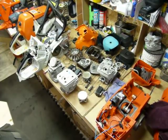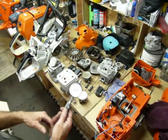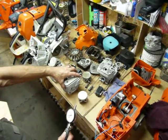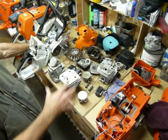That time is coming shortly, so we will be doing that. When you check the bore gauge in there — I'm pretty lucky to have a really nice instrument here — there's only two ten-thousandths of variance anywhere in the cylinder, which is really sweet. That means it's pristine in there.